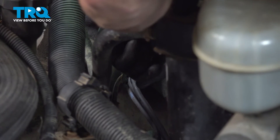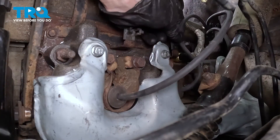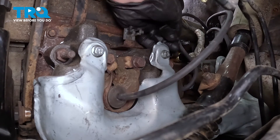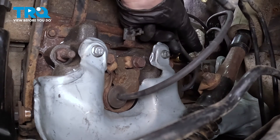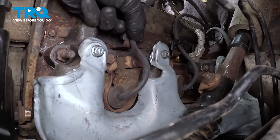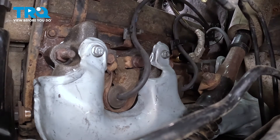Let's secure our wires. We'll make sure that we have the third wire along the rear of the driver's side down along the bottom port of the rearward mounting point. After that, we'll have the middle wire, and then the forward wire up along the top. That looks pretty good — let's latch it in. Moving along to the next mounting point, we have the middle wire. Press that in, paying attention to the slack on the cable itself. This looks good — it's not touching up against anything. We've got one more mounting point, and for this one we have a broken tab, so we're going to make sure it's secured with a wire tie.